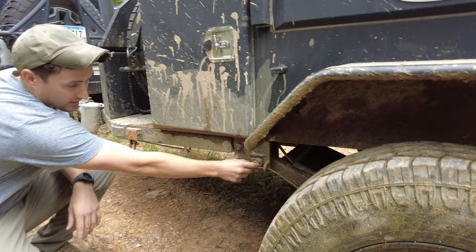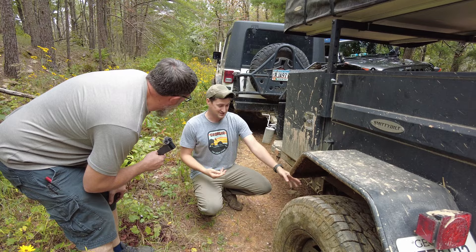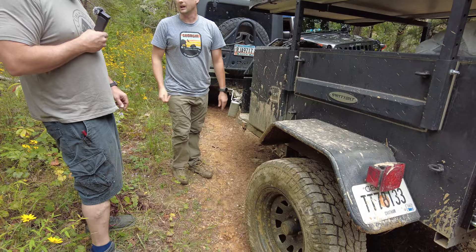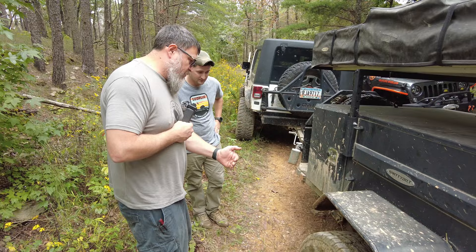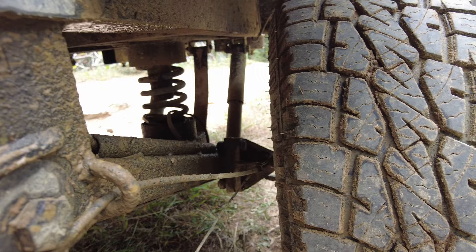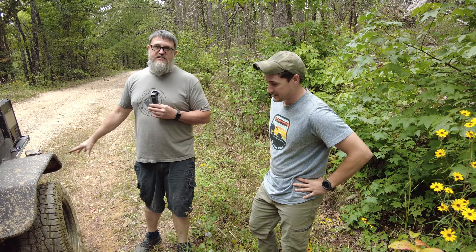You have to make sure the cam bolts are checked. The first time out, the tires slipped and there was alignment weirdness — it turned out the cam bolts had slipped. Those cam bolts are a key point of inspection before and after a trip because they control your alignment. With a trailing arm system, if a cam bolt slips it'll kick the wheel in or out front or back. That trailing arm with a quad shock system is the most off-road-centered suspension you'll find on a trailer — the same design Patriot Campers uses.